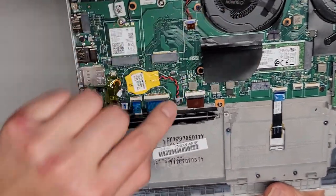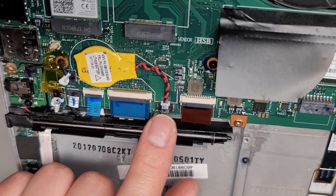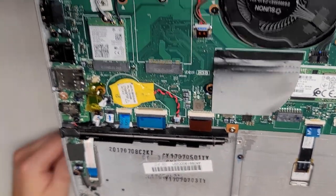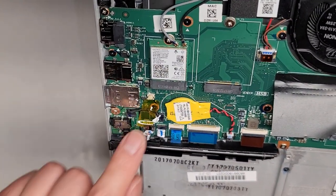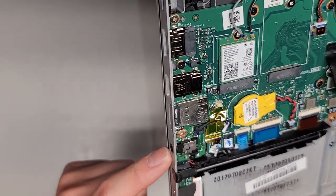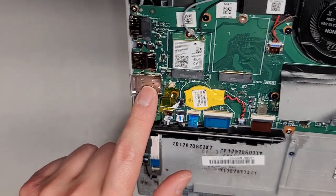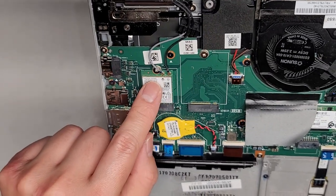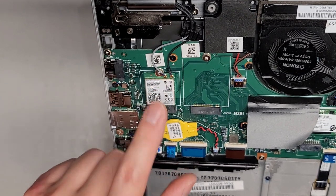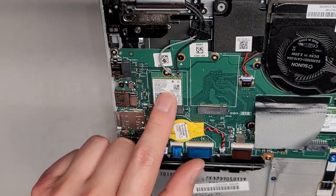This one connects to the hall effect sensor, and there's one underneath this little board that connects up here. Then there's a cable going to the fingerprint sensor, one for the keyboard, and one for the keyboard backlight. You've got the CMOS BIOS RTC battery here — real time clock battery. Grab that connector, wiggle and pull it out. When you replace it, make sure you get the orientation right — the black wires go towards the keyboard connector and the red wire towards the keyboard backlight connector or touchpad, to make it easier to tell. You've got this little connector going to the board for the headphone jack — actually a headset jack, so it does audio and microphone. Here you can see the SD card slot. You've got the wireless card here with antennas — go from the tail and pop them up. I don't want to mess with them unless absolutely necessary because the solder joints can be kind of weak and sometimes break off.